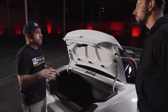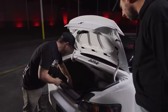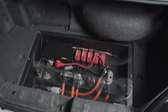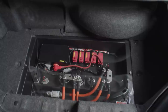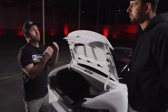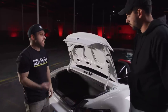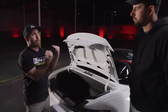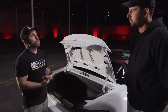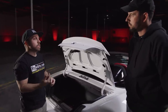So really what it is — it's sort of complicated but sort of not at the same time. Positive and negative side of the motor needs contactors. I have two battery packs essentially together. So I will have power coming in on two fuses right here. And then I have my negative contactors and my positive contactors. There's two of them kind of stacked together because I got two separate packs. And then these over here are for my water heater that heats the batteries, because batteries are happy with a certain temperature range.